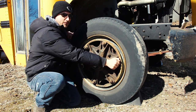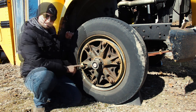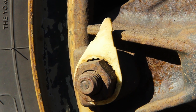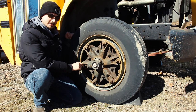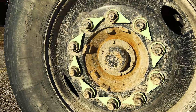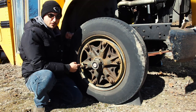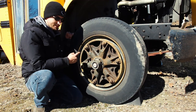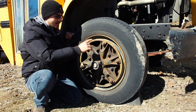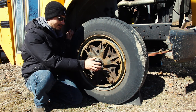If there is any wiggle in the lug nuts, do not drive the vehicle — get them retorqued. These indicators are called wheel checks. When a shop retorques your wheels, they slide these onto point to the next lug nut in line — there should be one on every lug nut. This way, with a visual glance as you approach your vehicle, you can tell if any have changed or come out of torque.